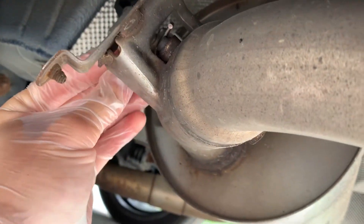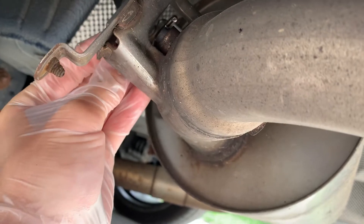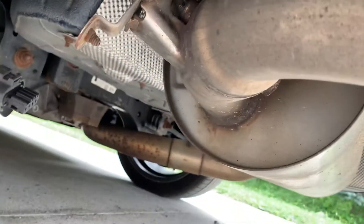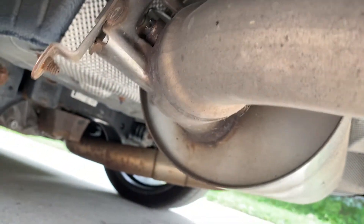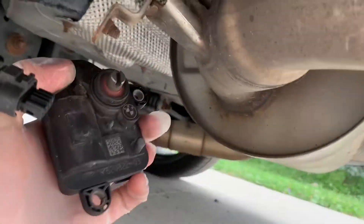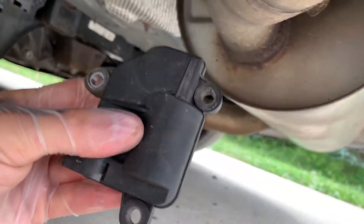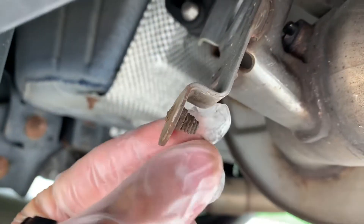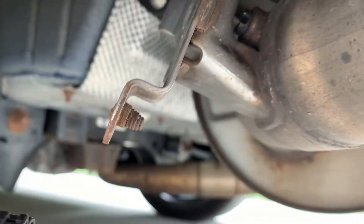When I bought the car, they had something like a metal zip tie holding it open or closed. Then that zip tie fell off and I was past the warranty. It's three 10-millimeter bolts that hold it on — you might want to grease them. It looks like they've done it before because one bolt, as you can see, is stripped and still in there.